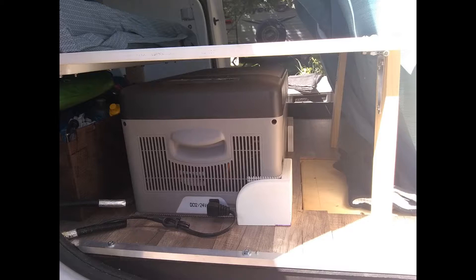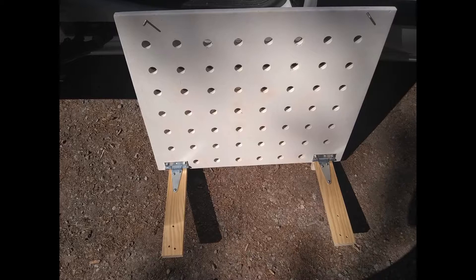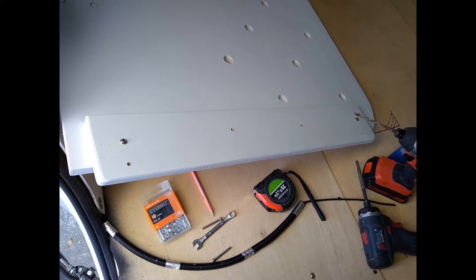For the rest of the length at the front of the vehicle, which would be behind the passenger seat, I wanted to create a support that was removable, and underneath this area I'd be placing my refrigerator. I wound up cutting a piece to fit in here that would be removable and lightweight by drilling some extra holes in it. The front supports are hingeable so that when you remove it those will fold up flat. This section is supported by the main platform using a plywood strip below the main plywood, which allows the short section to rest on it. I drilled the holes to locate it in relation to the large platform and put a couple of bolts through those holes temporarily, then drilled the holes for the removable platform where bolts would just go down through temporarily.